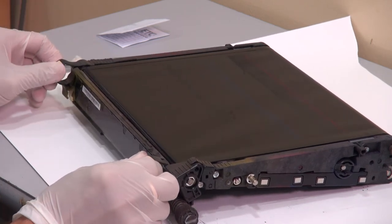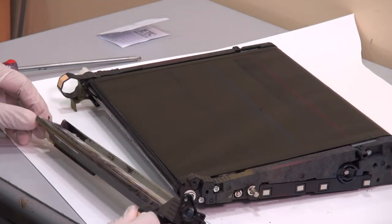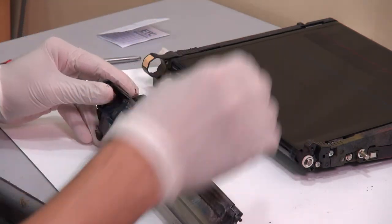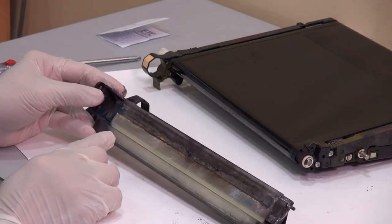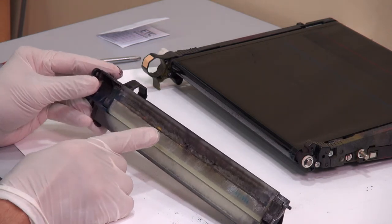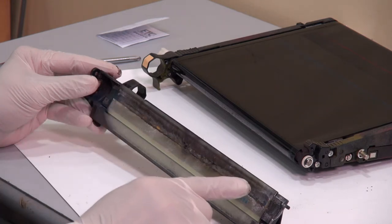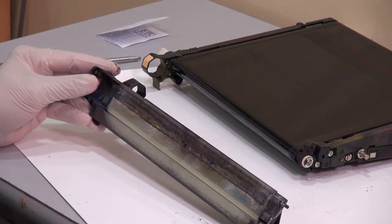Pull. As you can see, this is the most common problem of the Xerox 6605 — the paper dust and the waste toner will not go inside, going to the waste toner container. So the problem is it will get stuck here in the cleaning blade, then it will cause dirty printing and photocopying.